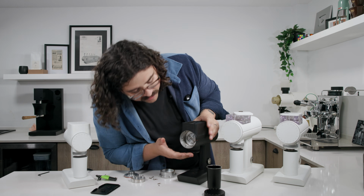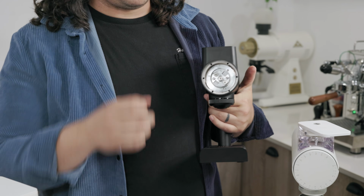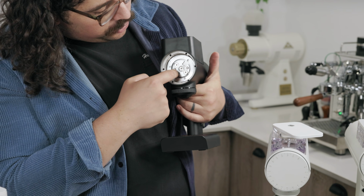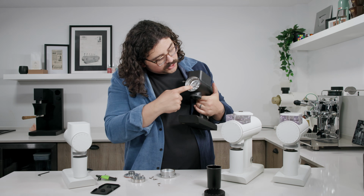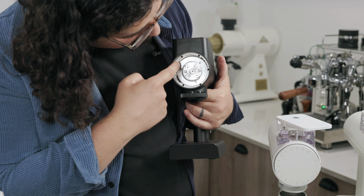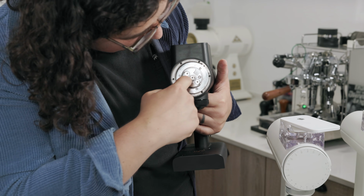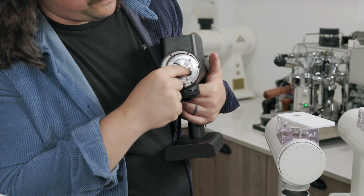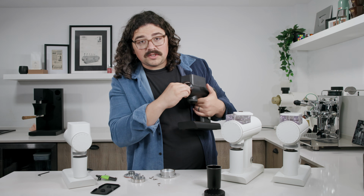So as you see, this is much different than a typical grinder. Now, obviously it's vertically mounted burrs, which isn't unusual, but what is unusual is the way that the burrs are mounted inside. It's very unique. So as you see, you have this big groove here, okay? You have a groove here, all right? So groove and groove. That means that whenever you're pulling this burr out, you've got to get this little clip type deal. You're going to push the burr in because it's spring loaded, right?